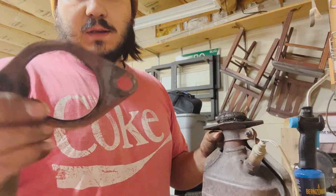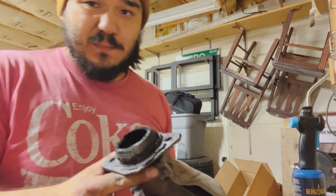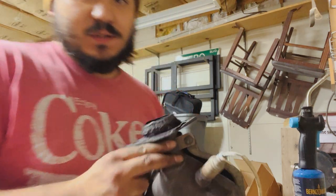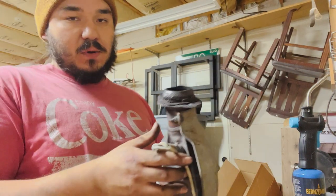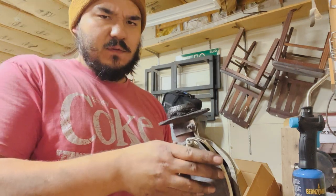Cat's out. I got one gasket — as you can see it's kind of crumbling and falling apart. I believe this is a donut on here; it's real bad, real ugly. So you've got the honeycomb inside the cat — I'm going to try and hammer it out with a chisel, break it apart, knock it out, and then I'm going to go pick up a donut for this — maybe for myself too.